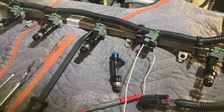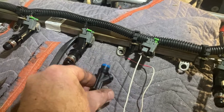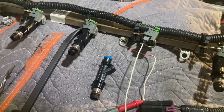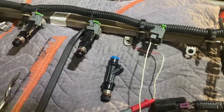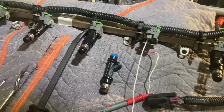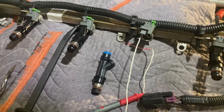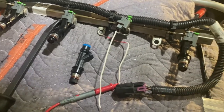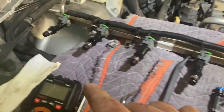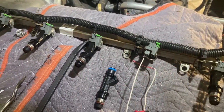So I have the fuel injector out. I measured a resistance of 16.5 ohms on a digital gauge. I have continuity, but I'm not quite sure what the resistance should be. One source said 15.9 ohms. The best practice seems to be to take all the fuel injectors out, measure all the resistance, and make sure everything is at the appropriate resistance.